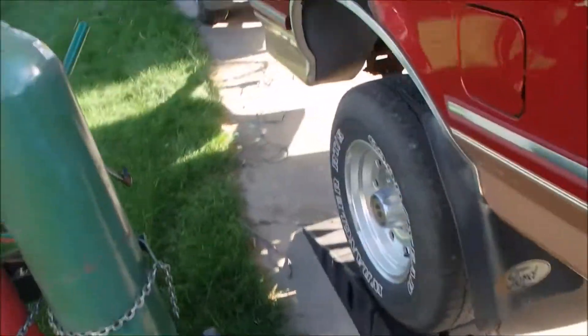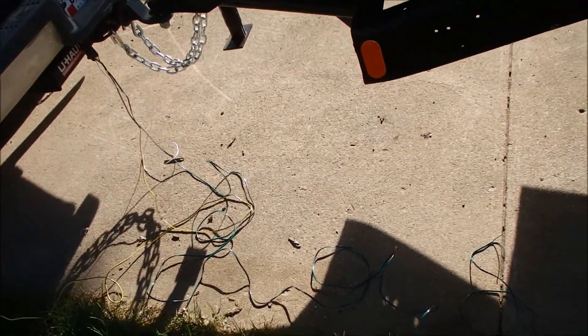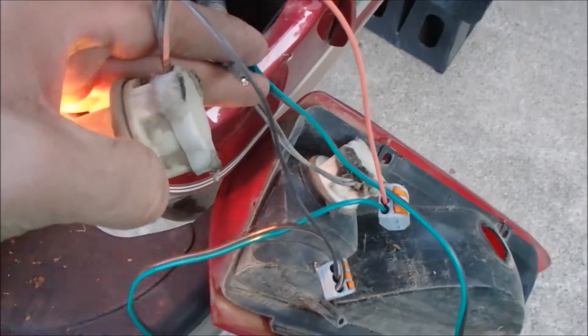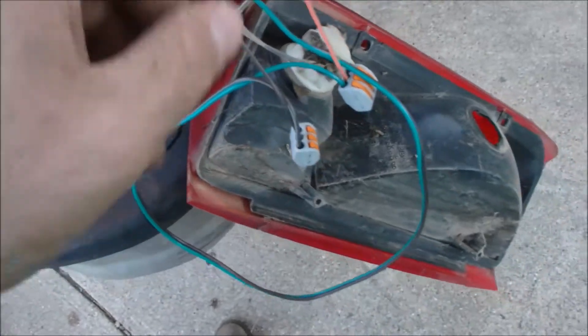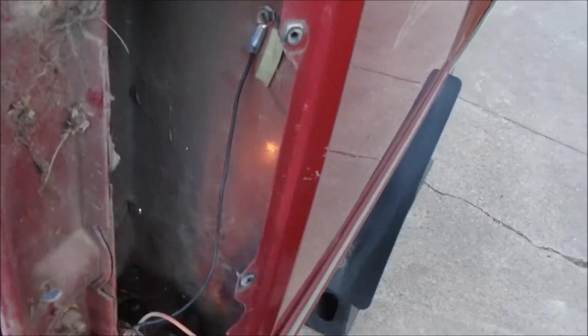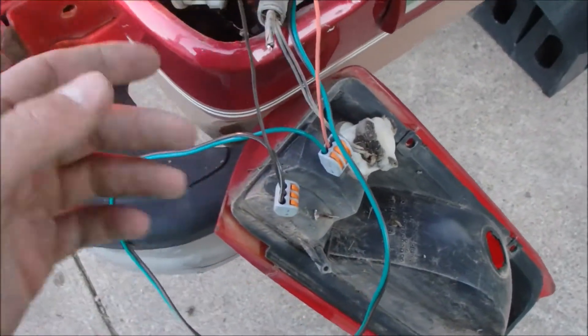If you have a long trailer or a very wide trailer, you're going to have to split it down each side. So before you start cutting, run the wires to where you think you want them to go and make sure it will all fit. I'm going to use this on the hitch side to keep it all nice, tight and bundled together. What I did was I just cut the factory wiring off, as you can see there. The bulb is incredibly hot. That factory wiring I just cut off. These are just temporary until I can get an actual automotive style crimp connector on there, but I just grounded it with a screw right there.